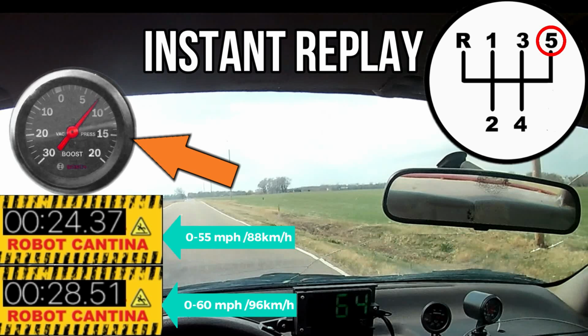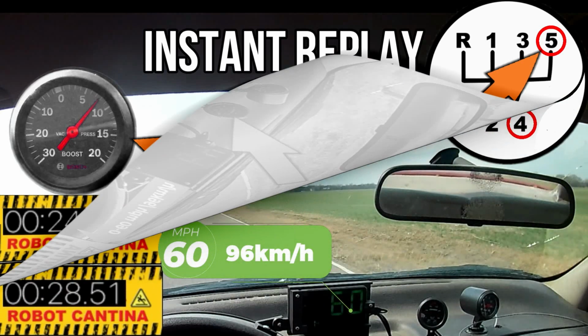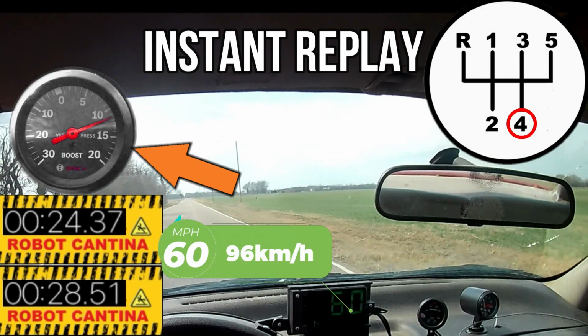So this snapshot is showing the boost a few seconds after I shifted into fifth gear, and even though the accelerator is floored, we just don't have the boost that I was expecting. Now the boost will eventually hit 10 PSI, but by then the exhaust gas temperature alarm has already gone off. So in other words, the exhaust gas temperature alarm is going off in fifth gear after we've completed the acceleration run. However, it looks like we still have the full 12 PSI boost when in fourth gear,